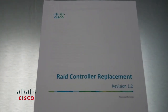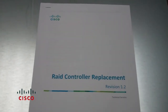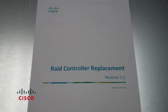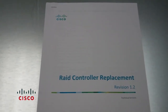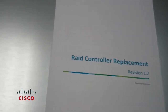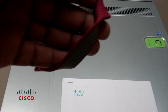The details of the MOP have more specifics covering stopping the UCS in a controlled fashion and restarting it. At this point we just want to cover some of the aspects of the physical replacement of the cards, once the UCS has been powered down and removed from its rack. Make sure that when you're using this particular MOP you have your ESD protection. In our case we've plugged it in to our earth circuit and that's the one we'll be using.